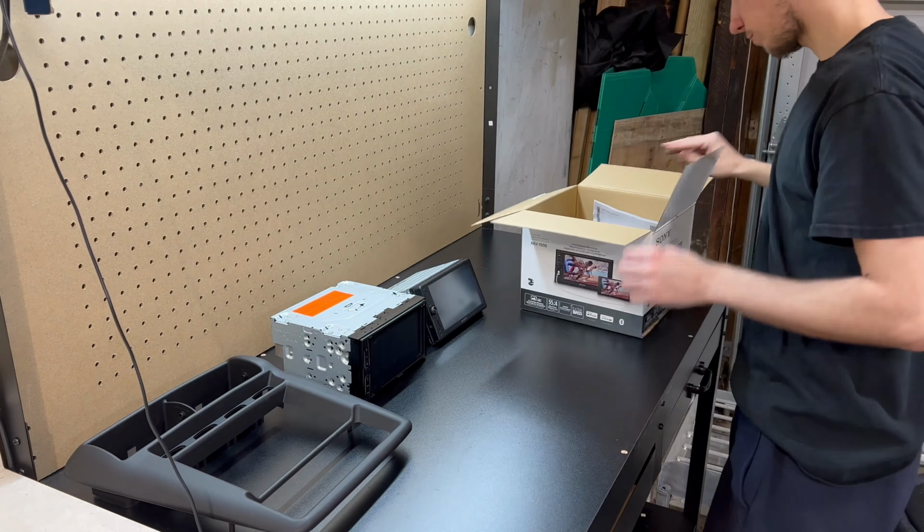okay, now we have to unplug this little piece here. Push this clip in. Alright, so just like that, this piece is off, but we can't just toss this. We have to reuse the vents here, and then gotta get those out as well. Next, I'm gonna use this 7mm to get these just two bolts here on each side. And we'll keep those for later. Now, we'll tuck these wires out of the way. Now we can take this out.